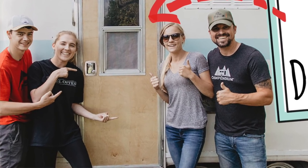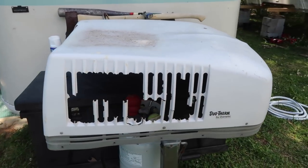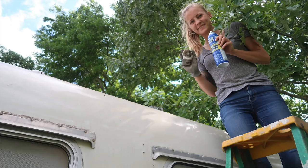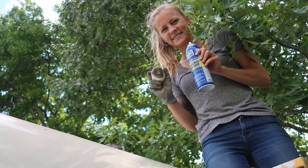Another project we tackled recently is replacing the old AC shroud — it was just brittle plastic, busted up about a year and a half to two years ago from a branch, and we just never replaced it. We finally got that replaced, and while we were up there, we went ahead and cleaned the evaporator coils and the condenser coils. Our AC is cooling much better now — those things were so dirty and we had never done maintenance on them before. One of the last projects before we head to Texas is using some of that leftover paint from the frame to coat the rusted areas on the Fiberstream frame, and we're going to repaint the toolbox too.